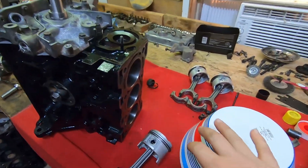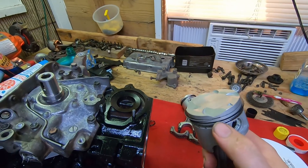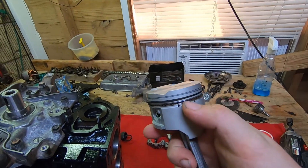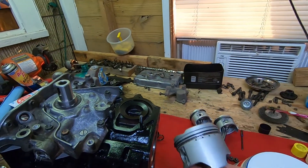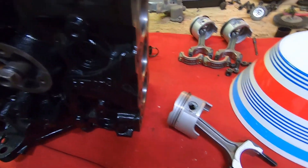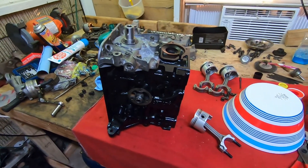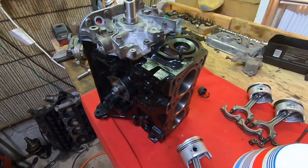You saw me assemble the pistons — pretty simple stuff, mainly with the rings. The top ring goes in one position. The secondary ring is 180 degrees from the top ring. The oil control rings aren't super critical — you can put them wherever you want, just as long as they're not lined up with each other or with the gap in the oil control ring. We're going to oil these up, put the bearing on, and slide them through this way, then bolt them on the other side. There's no good way to record this from both angles with one camera, so the camera goes up and you get what you get.